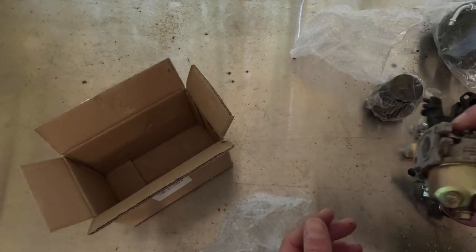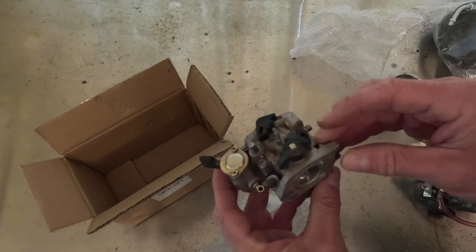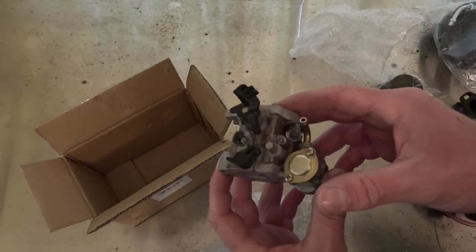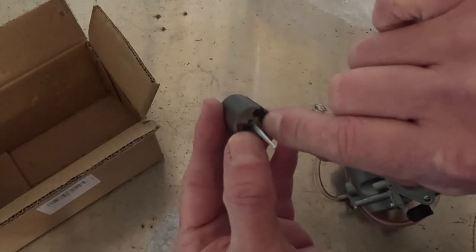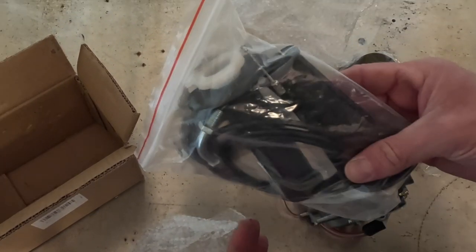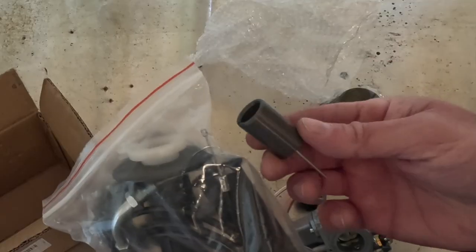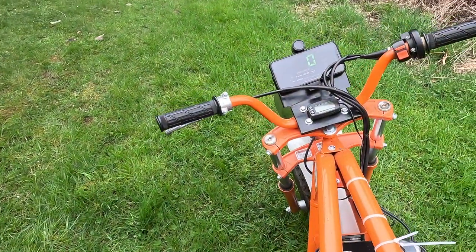On the carburetor that comes with this six-and-a-half horsepower engine, the linkage is quite different because it's connected by a rod to the governor, which opens and closes the butterfly. The end of the throttle cable is just the cable itself, whereas on the Mikuni clone the cable fixes into a point on the slide. So rather than messing around with the bare-ended cable on the bike, I've bought another throttle control that has the proper end on it — that's the part that goes into the slide in the carburetor. Links to these parts are in the description.